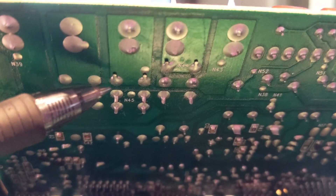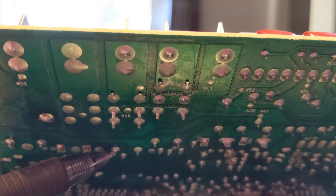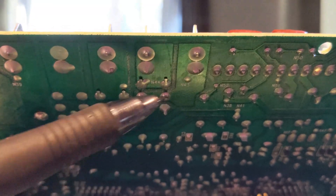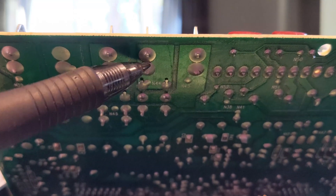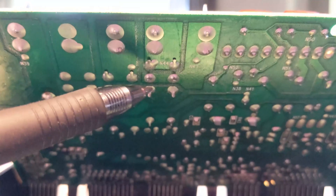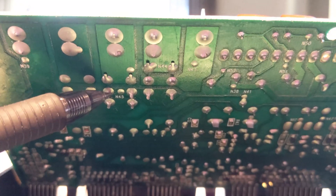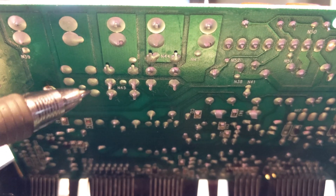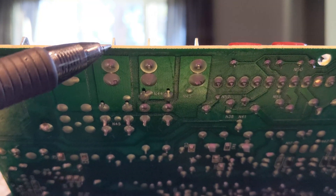If we look under the board, you can see where the terminals are coming out. We've got one, two, three sets of terminals followed by another set out at the end. Basically what's going on here is power is being fed in at the power input terminal, coming into the center terminals on this relay. It is either being fed to the broil element or down, which then provides power to the center terminal of the second relay. That second relay then has the option of providing power to another relay that is not used in this board, or powering this bake element right here.